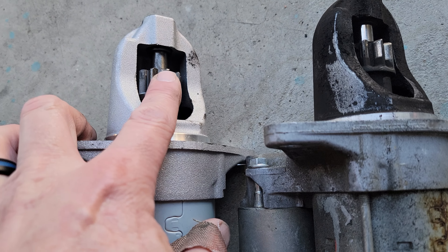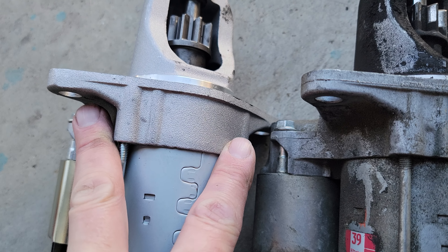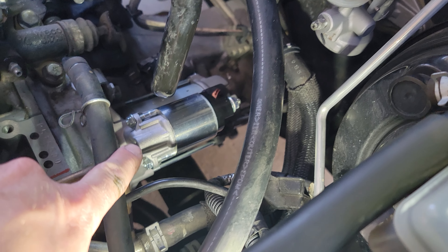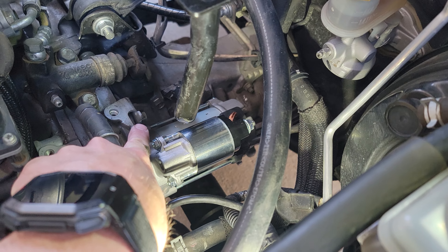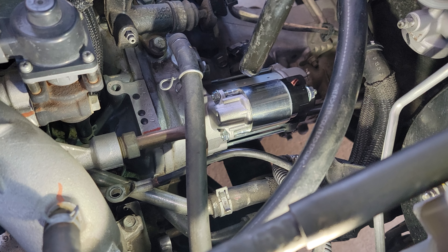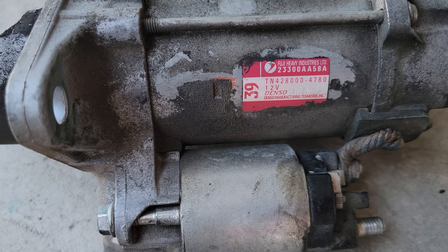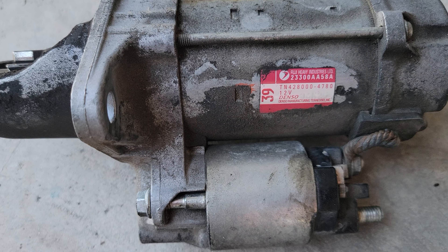Now that we've got the new one in — you can see my greasy fingerprints from counting the teeth — everything is the same. Now all we've got to do is reverse the steps. Get both bolts started, and remember to put on all the brackets you took off. It's easier to tip it in through the backside or underneath, start the top one first, and this bracket needs to be flat with a little catch on there. Get the bolt finger tight all the way in — that will help line up the lower one. I do hear some people saying they got the wrong starter and are holding it with hose clamps — I would discourage that. Get the right one, and that's why looking at your part number is so important. I cleaned it off before and zoomed in with my camera to get that part number, because that eliminates the mistake of taking it apart only to find the new part doesn't fit.